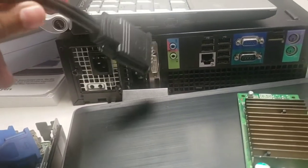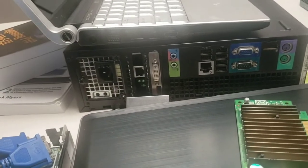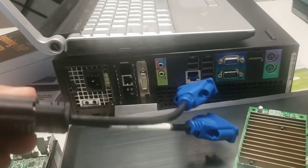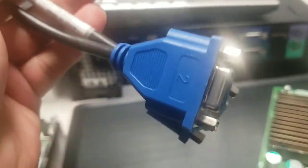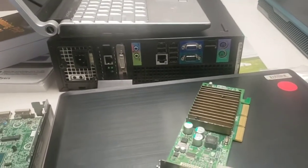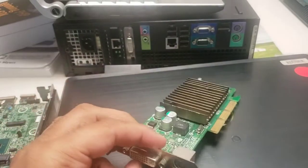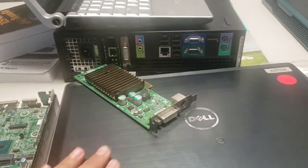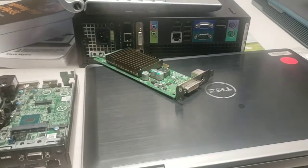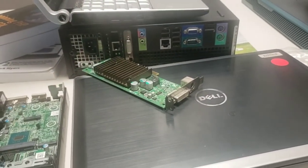Make sure whatever you use, you look at the back of the computer or laptop and see what ports are available, and then based on that you want to buy your monitors. Some really old ones can come with two VGA hooks, so it will connect and you'll have two VGA outputs — one will go to one monitor and another will go to the second monitor. A lot of laptops come with HDMI on one side and VGA on the other, and some may have two HDMI outputs going to different monitors.